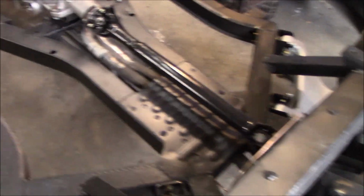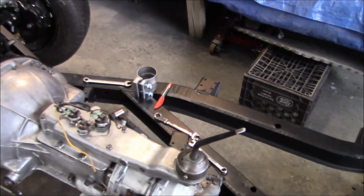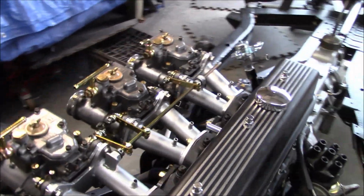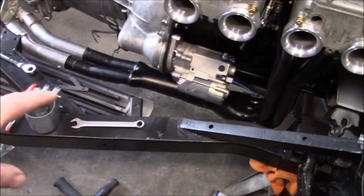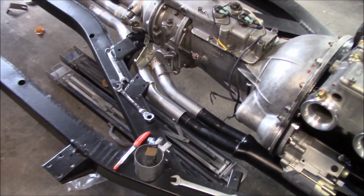So I think what I'm going to do now is pull the rear pipes out, and I'm actually going to solid mount clamp the mid pipes and the header pipe. I don't have the clamp on the collector yet, and that tends to want to twist a little bit when I start manipulating the pipes. So I think we'll hard mount the collector, and we'll work our way back from the mid pipes back, and then we'll stick the exhaust back in the rear.